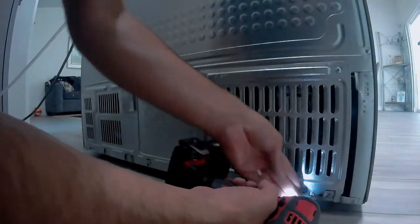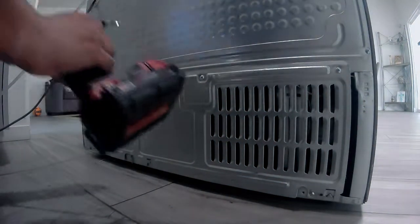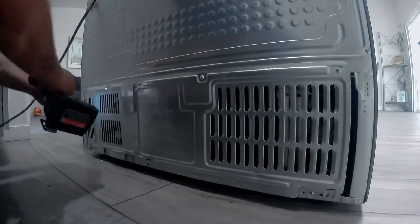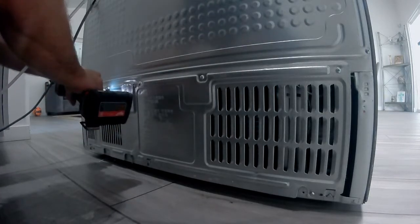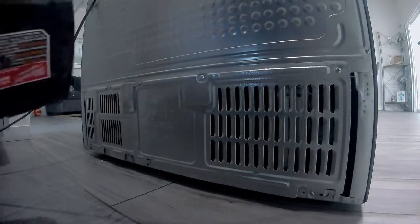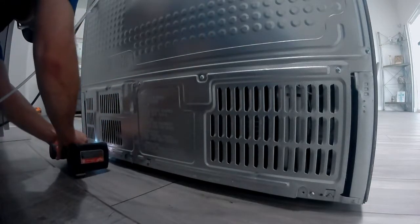So we're going to replace all the screws, and then that's it. You're good. It's important to replace these every 2 years, or do the ice maker repair if we're getting frost in the ice maker. But just as general maintenance, you want to clean that condenser once a year or every 6 months, depending on how dirty it's getting, and you want to replace these tubes every 2 years. They'll save you a lot of headache on these Samsung refrigerators, I'll tell you that.